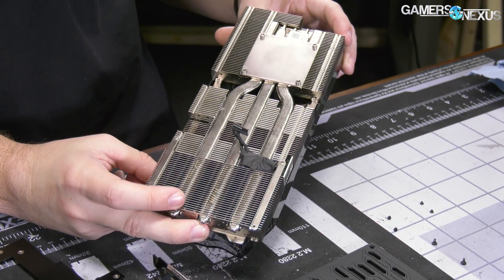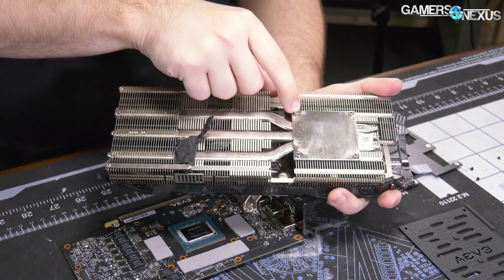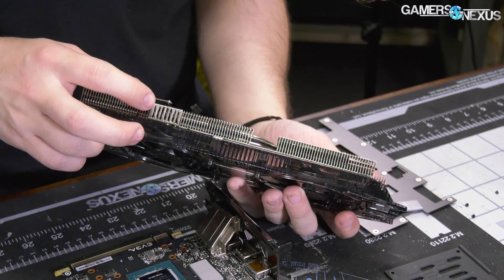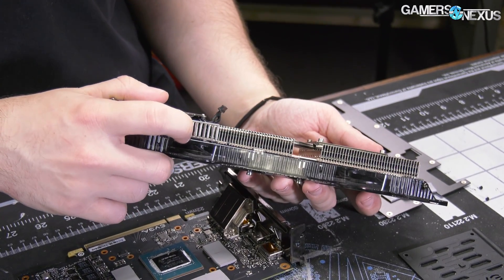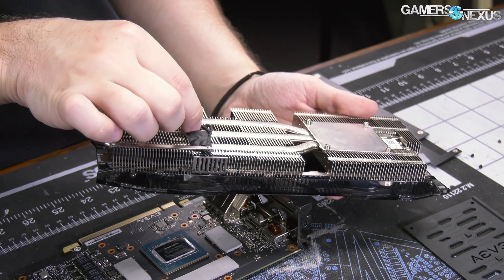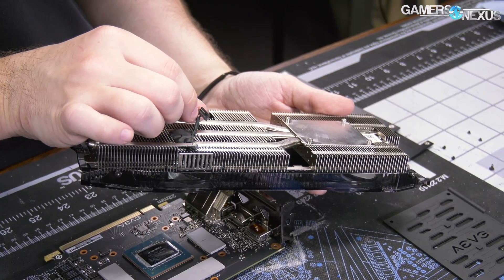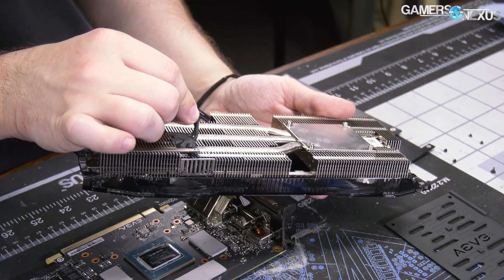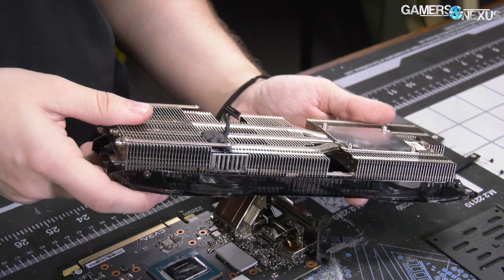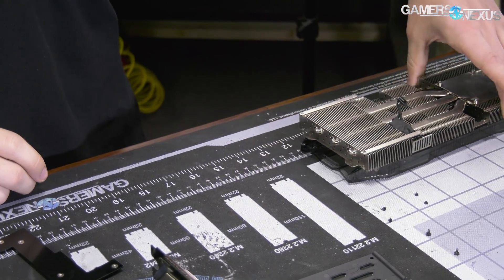So there's the rest of the cooler — pretty basic. It's got two fans and a couple of 10 millimeter heat pipes. As for the cold plate, it's nickel-plated copper. The heat pipes are copper, nickel-plated as well — that's important because it's a cheap card and you never know if it might go aluminum, but these are indeed copper. They also have a gate to hide the cable and they tape the cable down. The cable's not using all the pins either — I believe they could fit LED functionality or maybe another fan into this header. You can see they're only using about 60% of the header. This card has no LEDs, so that may be what it was originally intended for in higher-end models.